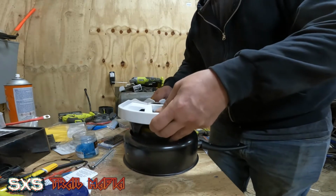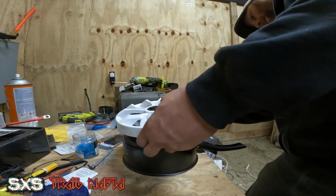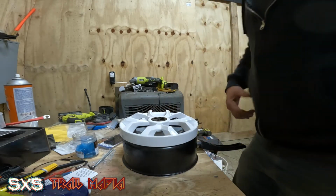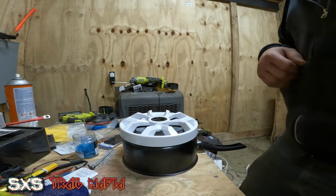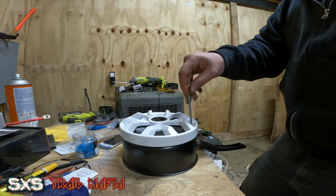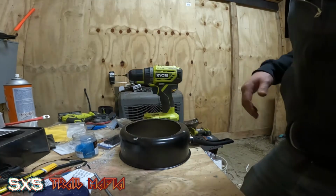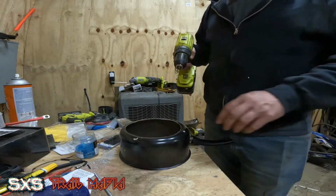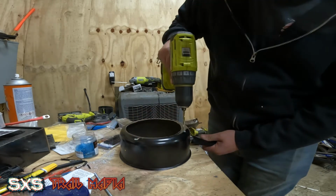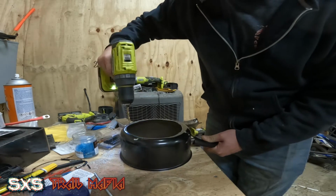Maybe grab a smaller drill bit so that we can have this all set up. And I'll drill out these holes with a smaller drill bit and then set them up to run our 10 by 24 right through. So I'll be right back. All right, so I came back with a smaller drill bit. I drilled this out. You'll see that that one walked, and that one. So we're going to drill these through.